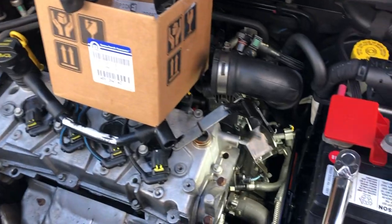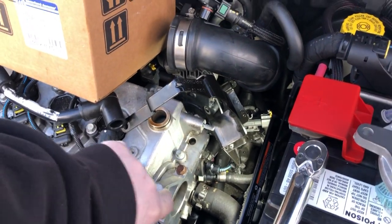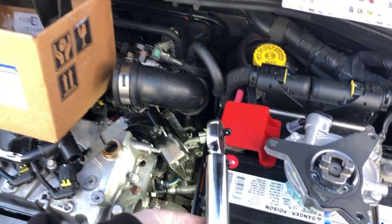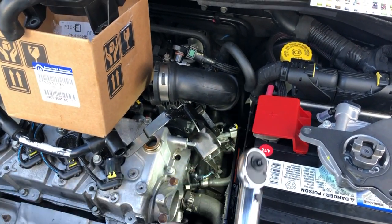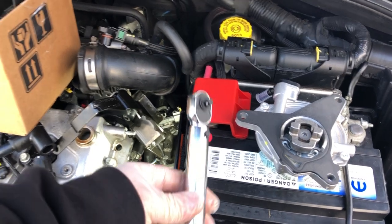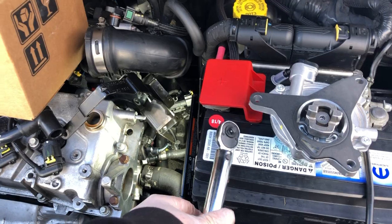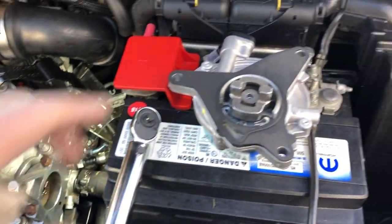I hope this will help you when you go to replace it. The T45 screws take 15 foot-pounds. This is an inch-pound torque wrench right here. If you convert inch-pounds to foot-pounds, 15 foot-pounds times 12 is 180 — so 180 inch-pounds is what is required to tighten those bolts. That's why I got this little quarter-inch torque wrench, trying to do it the right way.